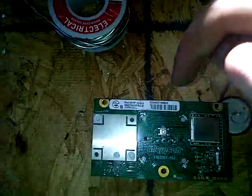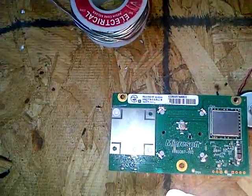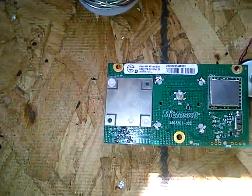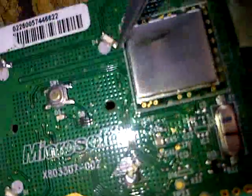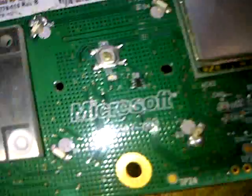What you're going to do on this LED — this is the top of the board right here, bottom. Top, bottom, left, right. So you're going to take the top left LED, which is going to be the player one LED. Solder from the middle contact point to the far right upper contact point. So it'll be that contact point to there, like that, on this LED.